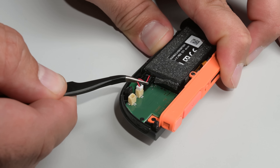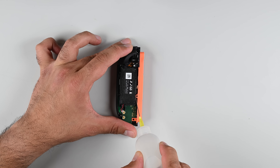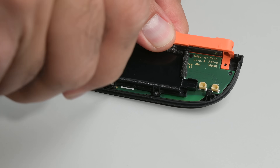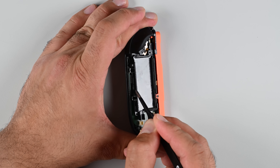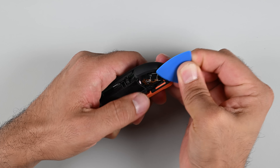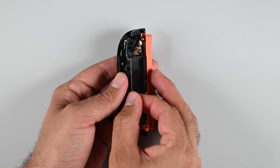Inside the Joy-Con, the 1.95 watt-hour battery is front and center and can be disconnected immediately. Easy to disconnect, but to pry it out I need a pick and some isopropyl alcohol. The battery tray is next, and it's not obvious how to remove the trigger holding things down. After consulting with three other teardown engineers, it turns out the trigger pops out with a little pressure — not obvious, but easy. That opens up access to the screws underneath and allows me to remove the battery tray.